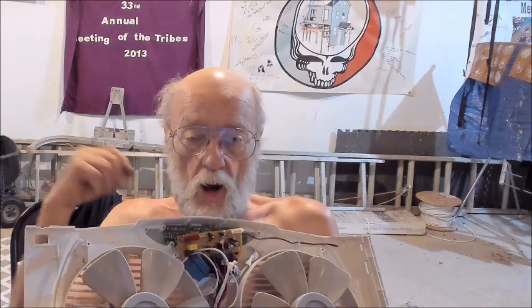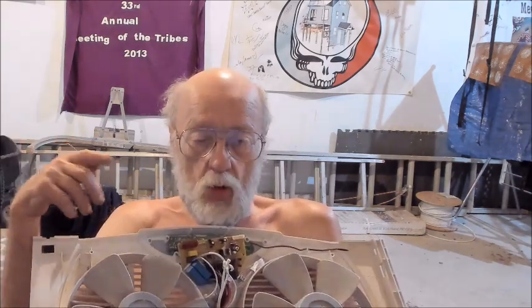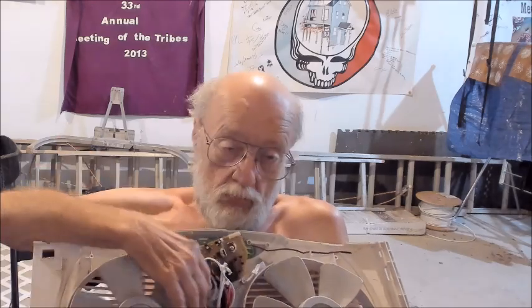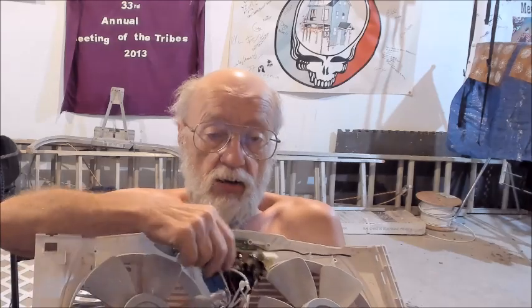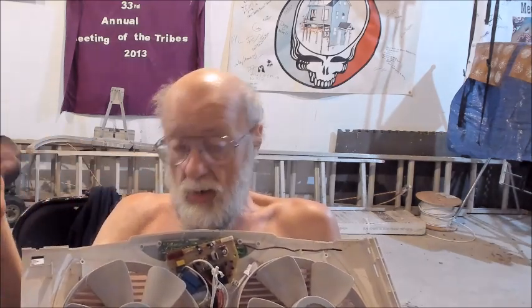No relay required. The switch will be for 120 volts, directly on the power cord, and through the run capacitors. That eliminates the logic board, eliminates the conversion of 120 volts down to 9 volts or 5 volts or whatever it is. I just power up the fan. In fact, I don't even need a switch, really. I mean, yeah, I should have a switch, but I could wire it directly, so fans only run when I plug in the cord, pull out the cord, and so on.